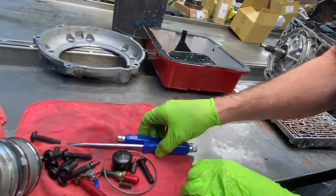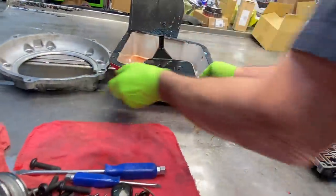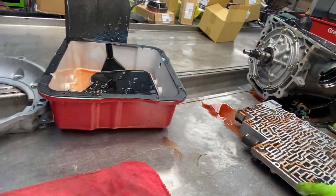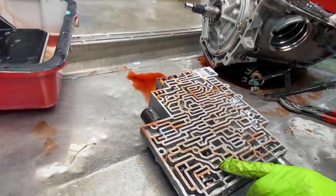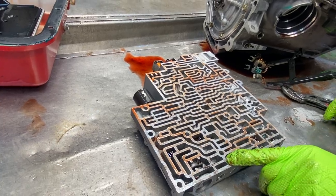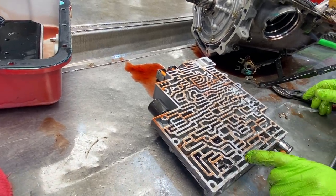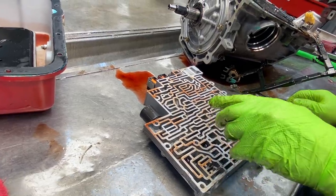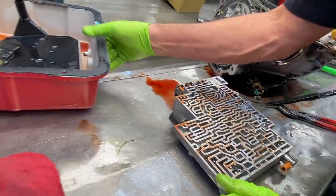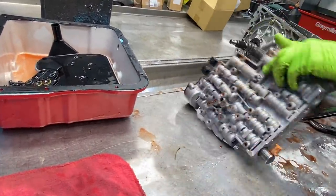Works really good. We do it on every vehicle that we do, whether it's your grandma's car, four-wheel drive, or anything like that. But if we do go to a multi-clutch converter, we have seen sometimes a pretty aggressive lockup. So you've got to remember that. We've had to go back in there and unblock it and make it physically work when we put a multi-clutch stall converter in there to make the customer happy. I wouldn't have been happy, and he wouldn't have liked it neither.